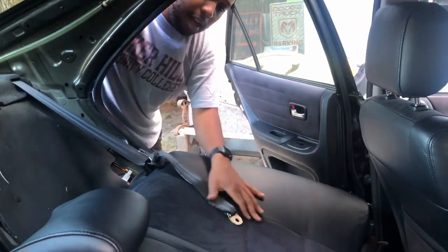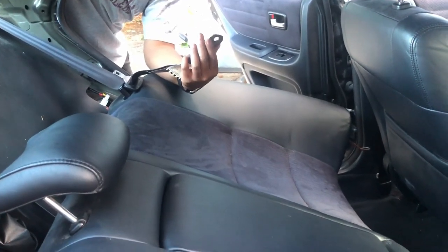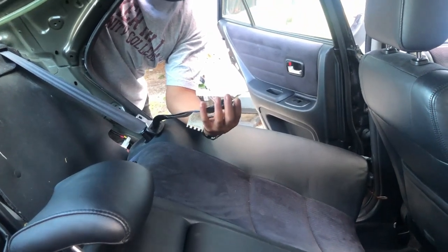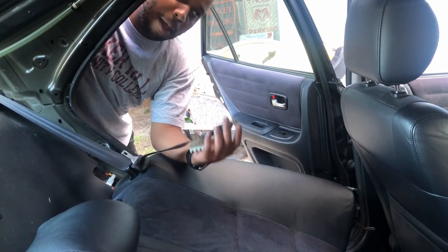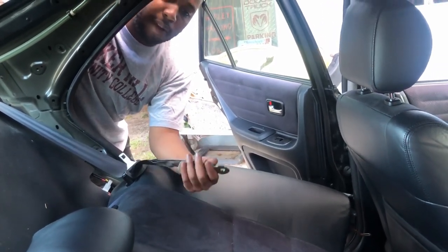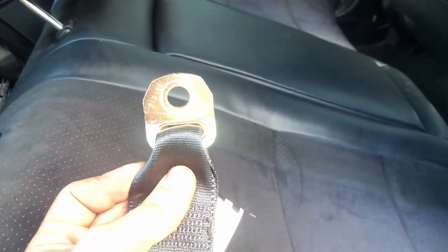One more thing — another way to make this easier: there are going to be 14mm screws on here. Make sure you take these out, it makes it a lot easier to pull the seat up. You're going to take three of them — there are four, but one of them is for the buckle so it's not really connected to anything. You just pull these three out that are connected to all this stuff right here, and then you should be all set.